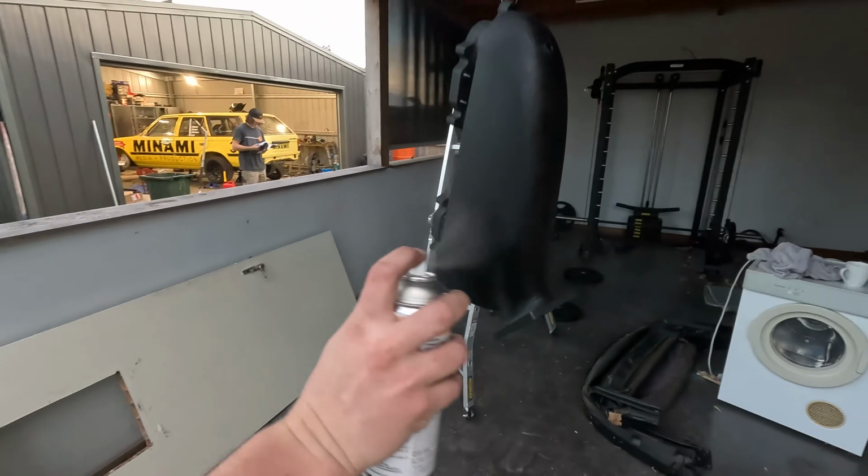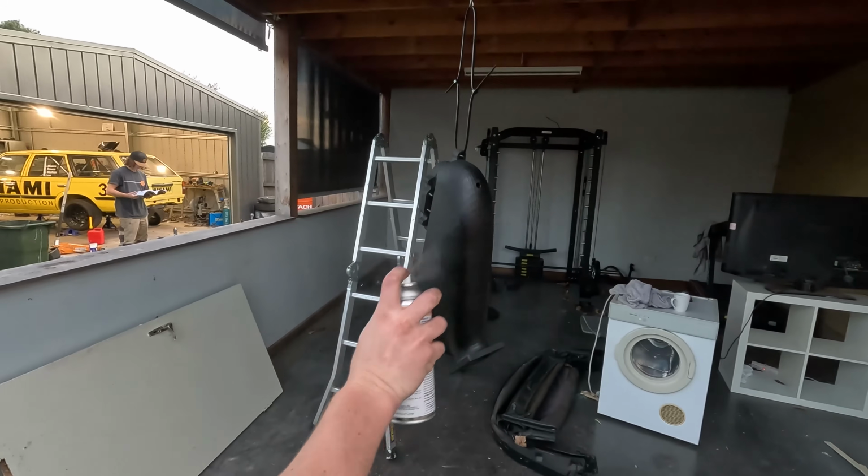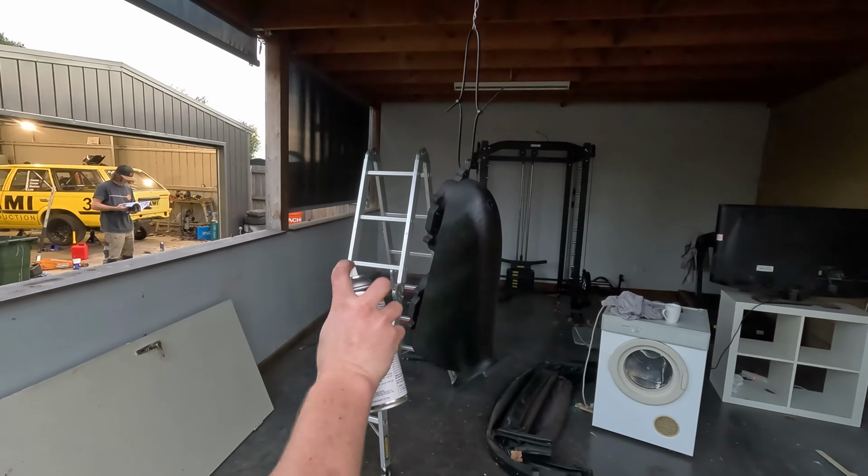While nylon does absorb moisture and geometry isn't super stable when there's a wet, moist environment, it doesn't degrade with fuel and oil and brake fluid and whatever else was floating around in our engine bay that could have dissolved our intake manifold. In an effort to seal, we painted the intake manifold with black spray paint until it stopped absorbing black spray paint. Yeah, quite a lot of it is black spray paint now. Quite a lot of the structure, I imagine, but it was high temp stuff, so all good.